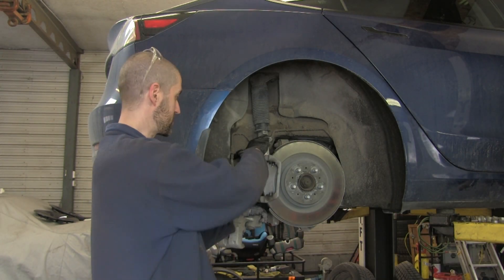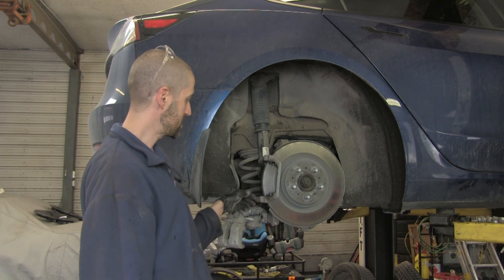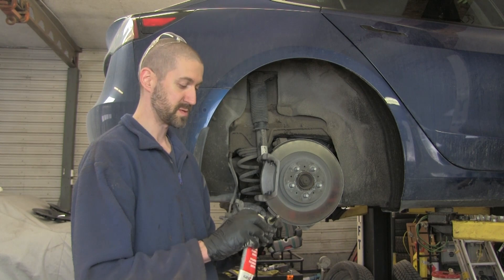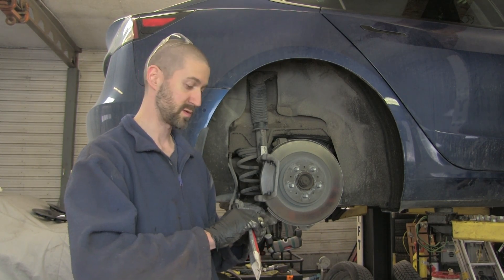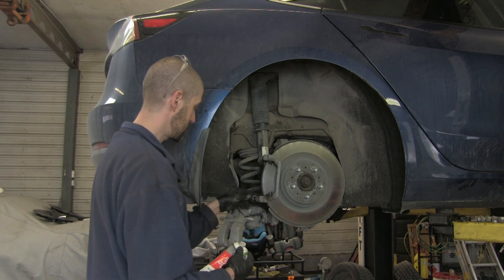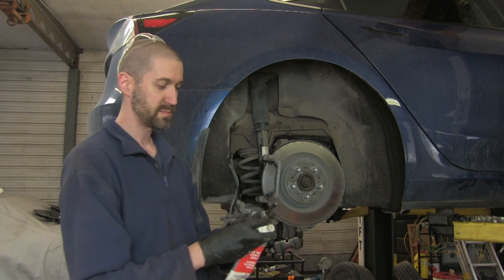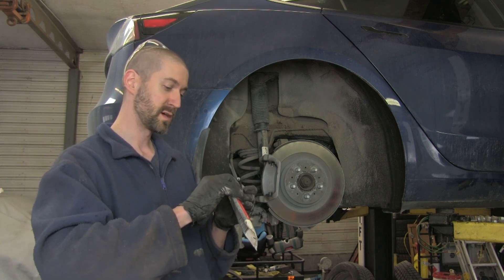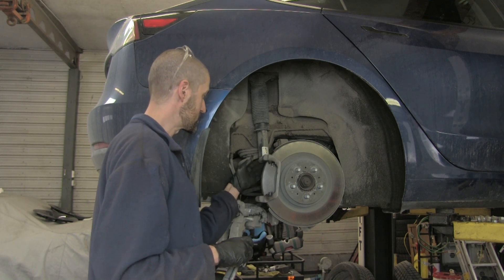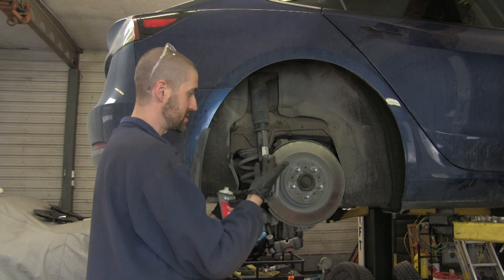The sliders have to come out as well. Just keep in mind where the little rubber one is — this one is in the top, so we're going to keep it in the top. For the bottom one, we're going to put a little bit of silicone lube in there. The reason we use silicone lube is because there are rubber parts in here and silicone will not affect the rubber. You just need a little bit, otherwise it's going to hydro-lock in there. Take it and swirl it as you put it in just to get the grease to spread around, and do the same thing with the top. Because if you don't use silicone lube, it can actually swell the rubber and then it gets stuck. Spin it as it goes in — make sure the lube goes all the way around so it's not hydro-locked.